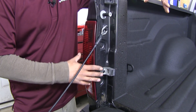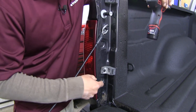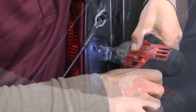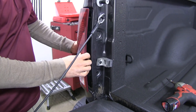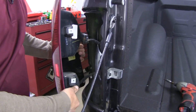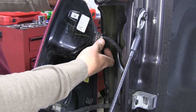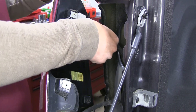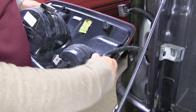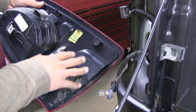Now we're going to need to remove our taillights so we can get access to the wires. I'm going to take a T25 Torx bit — we're going to have two screws on each side that we have to remove to get the taillight out. Once you have those removed, grab your taillight and pull directly back, then unplug the two bulbs holding the housing to the vehicle. On the bottom of the connector there's a red tab we'll have to pull out, and if we push in on the small tab toward the outside we'll be able to disconnect it. On the bottom it's easier to just turn the bulb and pull the connector out. Repeat that process on the other side.